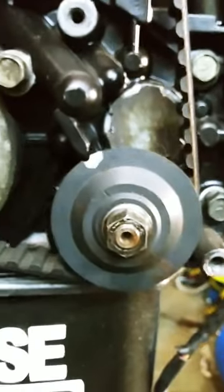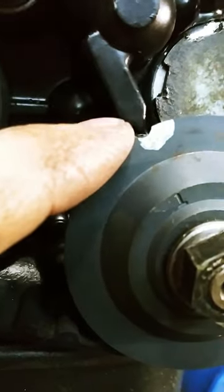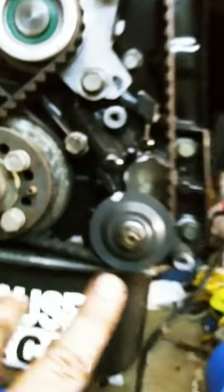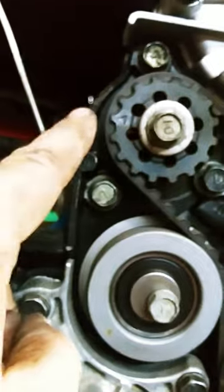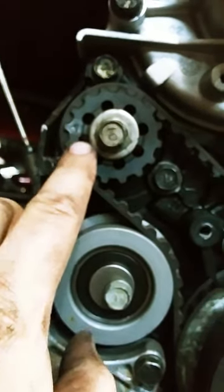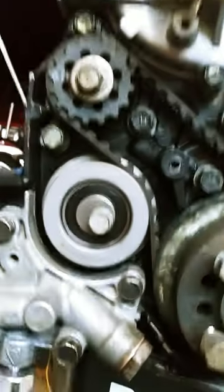Then you want to do the oil pump. The oil pump has a notch in it too — you want to match it up to this little arrow. Top dead center. Both those are set. On your balance shaft, same thing — this arrow just needs to go straight to the passenger side. There's usually a notch in here but this one's broken, so just go straight across, 90 degrees from top down, and you'll get it.